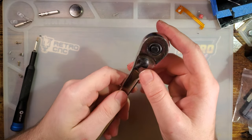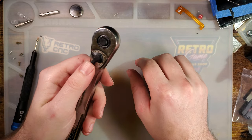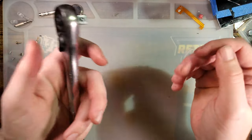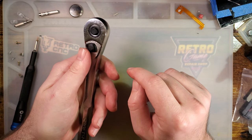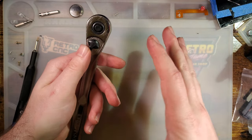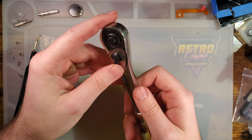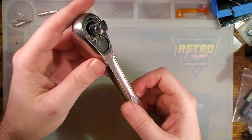For those that don't know what that means, it means the drive shaft was extraordinarily unstable. It didn't fully throw a U-joint — really it just threw one of the caps or one of the bearings on the U-joint, so the drive shaft was just rattling around. After some roadside investigation, we determined that the central carrier bearing had gone out a very long time ago. Surprisingly, we thought the shaking was coming from something else, but in hindsight it makes sense. Because that bearing had gone out, it had thrown the U-joint way out of whack, and every single rotation the drive shaft was doing something like this because it's a two-piece drive shaft. To pull the drive shaft and replace those bearings to repair it properly, I had to remove the rear axle bolts that connect the drive shaft to the differential on the rear axle.